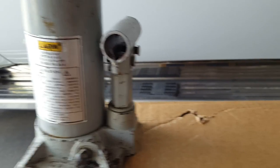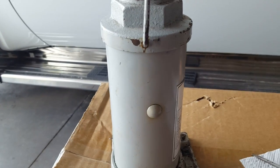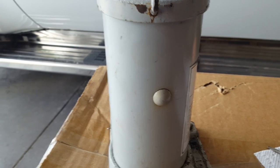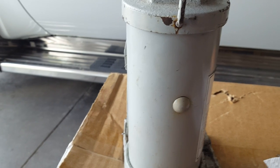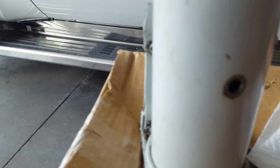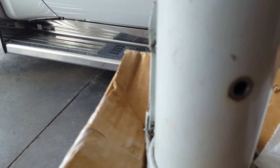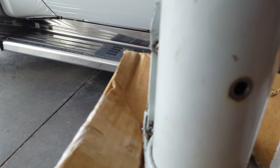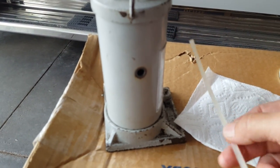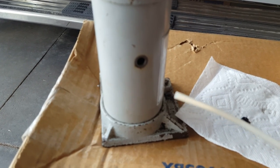The first thing is to remove the fill plug here, which I'll do with a little screwdriver — just pop that out. Now here's the only new thing I'm bringing to the party: take a zip tie, cut the tapered end off, and use it as an oil gauge.